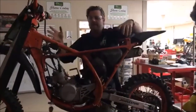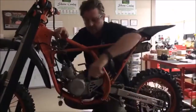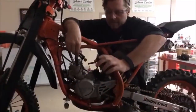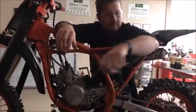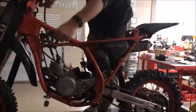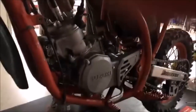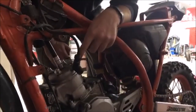Now we've got the gas tank off, so we're pretty safe here. Look at this one — this is the Mack one. It's not enclosed, but it has a ground strap so we can go ahead and do spark checking and compression at the same time. I said I'd show you a bad cap, so you might want to get closer to see the spark on here. We have no spark plug out, but would you agree you would not want spark ever going through the outside of this wire, outside of that cap?